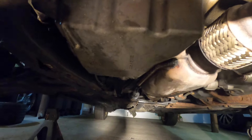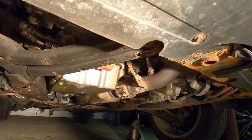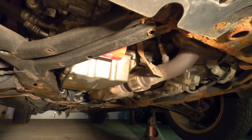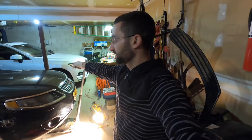We're going to drain the oil and recycle it because it's fresh oil still. We'll go up top, unplug the plugs, and release the exhaust. Pretty straightforward — you've seen me do it before. This is just the 2008 Copart Saab that we rebuilt. It's pretty nice actually for the age — we got very lucky with this purchase. I'll put the camera on fast forward while we drain the oil. I'll work on top releasing the top bolts on the exhaust and releasing the harnesses to the catalytic converters and O2 sensors.